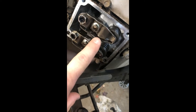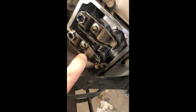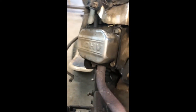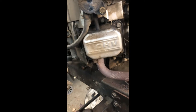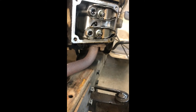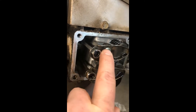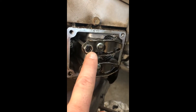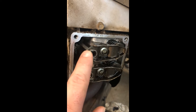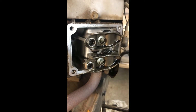This of course is your exhaust and this is your intake. They require a 5 to 7 thousandths clearance on the intake and 9 to 11 thousandths on the exhaust. You use a number 40 Torx to adjust and put your wrench on the outside. Take your time with it because it can be finicky — when you go to tighten your lock nut you can actually tighten up the other side. So just be careful and always double check your clearances when you're done.